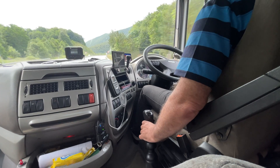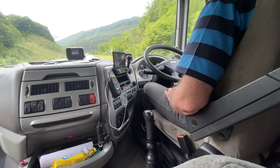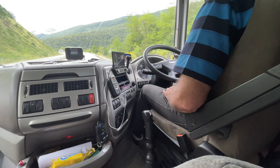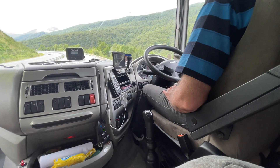I pre-select low — in fact I'm going to change it to low here. Just dip the clutch and it goes down into low, giving me those extra few revs to aid the exhaust brake on this downhill section.